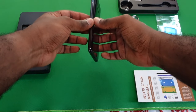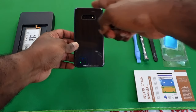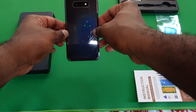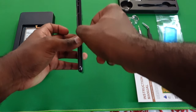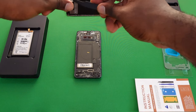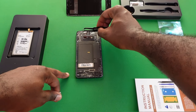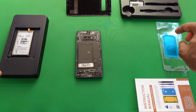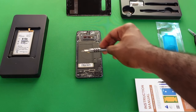The hardest part of this repair is getting the back cover off, since it's made of glass. Normally this involves using a heat gun around the edges to warm up the adhesive, but fortunately since my battery has produced excess heat over the years, the adhesive is pretty much worn out already. I'll use the tweezers to remove any excess adhesive around the back plate once the battery replacement is done.